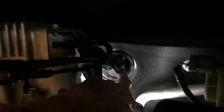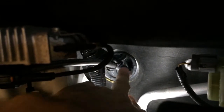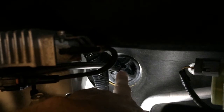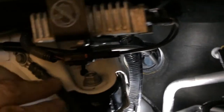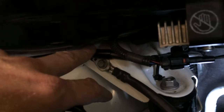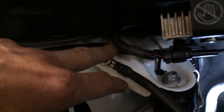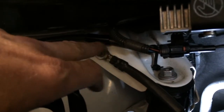Before you run this wire through, there's a little rubber cap on this penetration that I had to clip off with a pair of cutting pliers. Then I ran the power wire through and put a zip tie, making sure it's tucked out of the way, away from the engine. I ran it behind here with the ground wire with a little protection, and later I'll put some wire loom over that to protect it from chafing on any sharp edges.